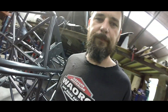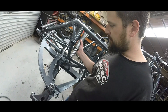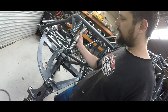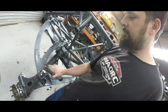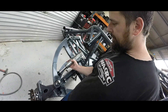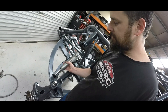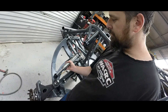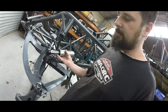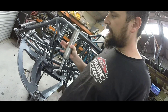However, on the front, 4 inch stroke is going to cause me a little bit of issue because of the angle that the bump stop sits on. You can see we're hanging on the limit strap down there at the moment. As this arm comes up, this is the bump pad, and if we just drop this down you'll see roughly what I'm talking about. As the arm comes up, this angle is going to change, and at 4 inches of stroke there's a point at which it's going to start to hit on this kind of angle. It's going to be putting a lot of side loading on the bump stop and potentially stressing the shaft.